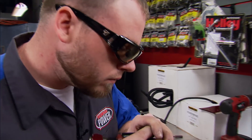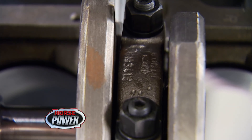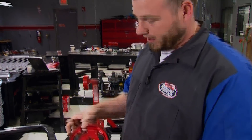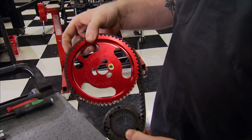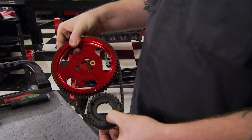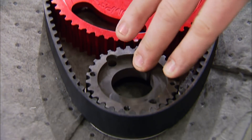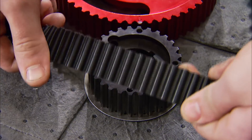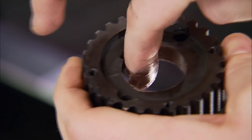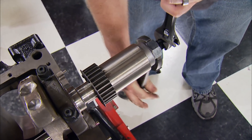We've got the crank and camshaft in. Now we're ready for our timing set — this one might not be familiar; it's even a first for me. It's Comp Cams' wet belt drive system, designed to go behind the timing chain cover for racers who don't want it outside their block. The cam gear is aluminum, the crank is steel, and the belt is said to be stronger and more reliable than a chain. With a little Loctite anti-seize, it's a press fit — not hammer fit — into place.